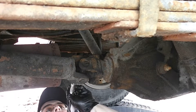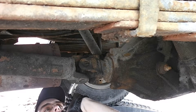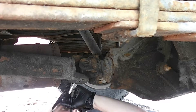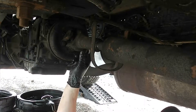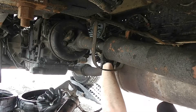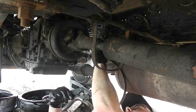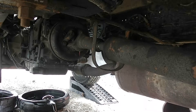I'm lucky it's accessible — sometimes you might have to turn it a bit. And it looks like our oil is all drained, so we're going to put the plug back on and put on the new filter.